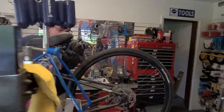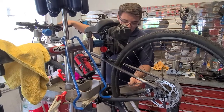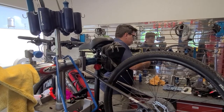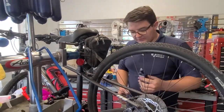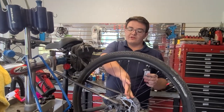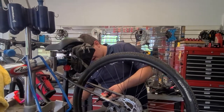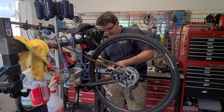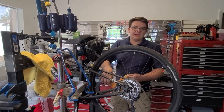The other thing that's good to do is lubricating your chain. It's always great to lubricate your chain. You've got a little bit of oil on this right now, and it's super simple to do. Any bike shop will have chain lube. We're a Trek dealer, so we use our Bontrager chain lubricant. Real easy to apply — just give it a quick shake-up. You want to keep this far away from your brake. This bike has disc brakes, so you don't want to get any oils on there. Just lay it over the chain, back pedal — five or six revolutions — and then get in here with a rag. I've got a microfiber rag, but paper towel or anything will do just fine, just to wipe off that excess oil.